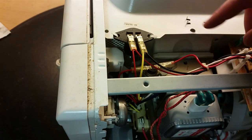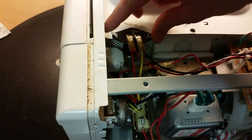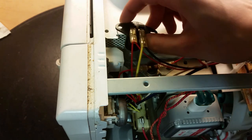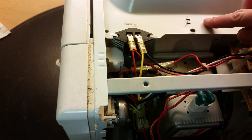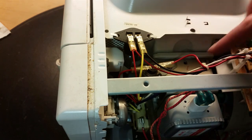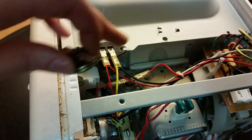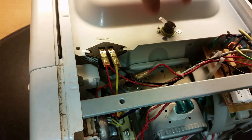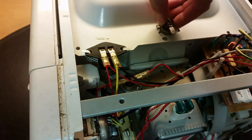And this is quite funny, they use this to save some money by avoiding the screws and screw terminals to keep this light bulb down. And here we got a place where we can actually put a thermal cutout, like this one down there. A thermal cutout fits perfectly in there. Look at that, it's like made for it. Or you can have it like this.